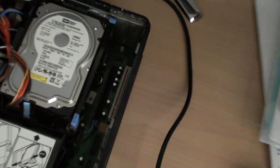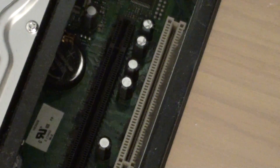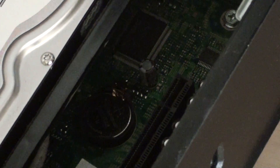Zooming in so you can see — it's just right below there. That's where you can locate the BIOS battery. Make sure you pull the power plug out of your computer and ensure there's no power, then simply push the metal switch back here.